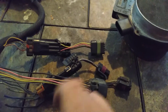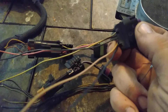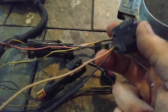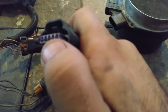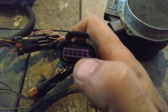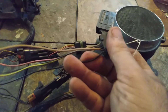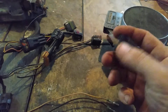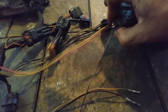With a safety pin, the plug goes the same way. We're going to keep three wires — we're going to get rid of the tan and the black wires, and we're going to keep the yellow, pink, and black with a white stripe wires. Start by taking your safety pin and inserting it into the smaller hole closest to the clip side, not the larger one. With a gentle pull — it may take two hands — pull this wire out and repeat the process for your brown wire. Now you're left with just the yellow, pink, and black wire with a white stripe.